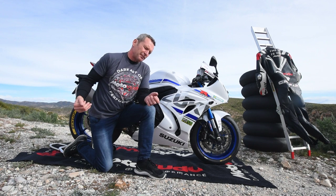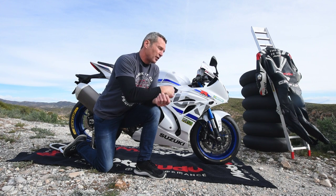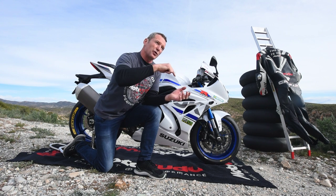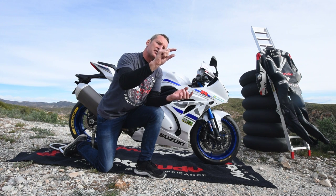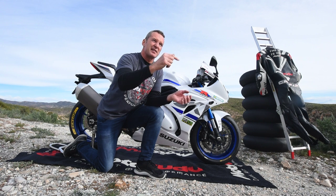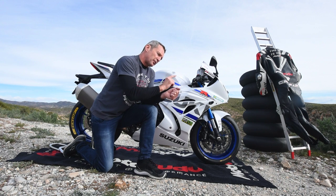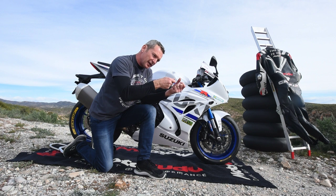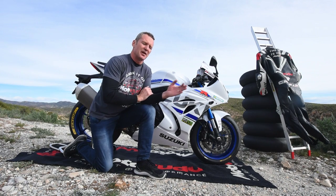Moving to the rear of the bike — because the rear shock is set for roads, potholes, and comfort — when you ride on track with all that power and good rubber, the rear shock gets compressed too much. So I put on a minimum of two turns of preload; four turns is even better, though the preload adjuster sinks below the swingarm level making it hard to reach. Then on the compression adjuster on the rear shock, put another full turn of compression. To check it's correct: turn it all the way in and one and a half turns out is correct. Again, I don't touch the rebound because it made no difference when I did.